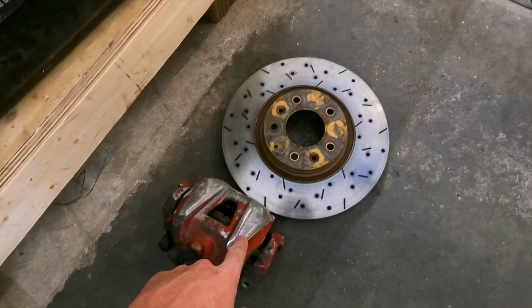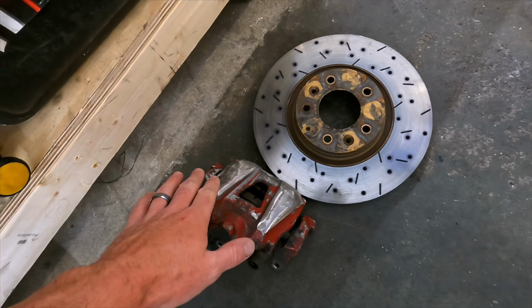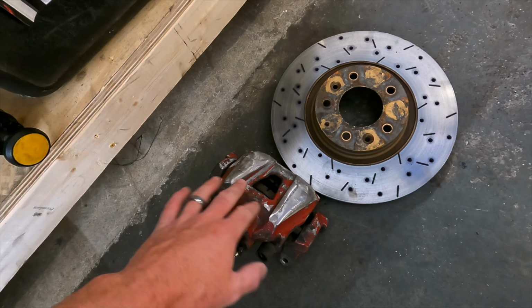out there who are looking to get a smaller wheel on there to get more tire, whether it be for drag racing, autocross, whatever. I have the Speed 6 brakes here and I was shaving them quite a bit, and it was honestly getting to the point where I was like, how much do I actually have to take off this? And I ground for a little while. But they told me that the regular Mazda 6 front brakes bolt right up to the Speed 6 and give way more room for the wheel, and that we wouldn't have any clearance issues.